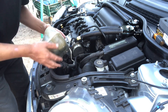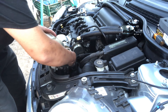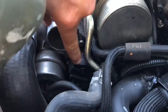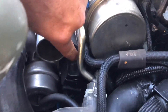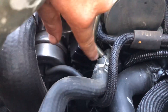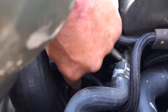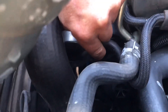You just need to move it enough to where you can get to your diverter valve, which is right here. Your diverter valve is located right here, right underneath your vacuum pump. There are three 5 millimeter Allen bolts holding it — there's one right here, one directly below it, and one on the far side on the bottom.